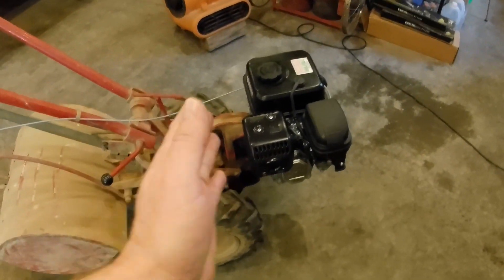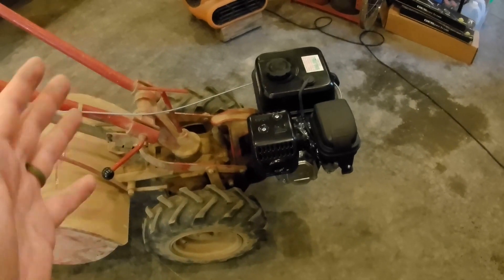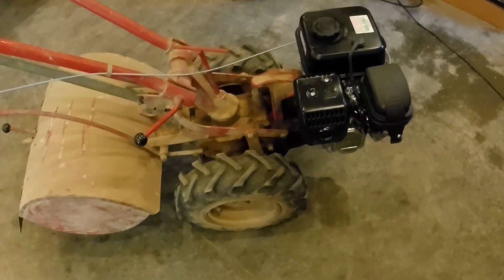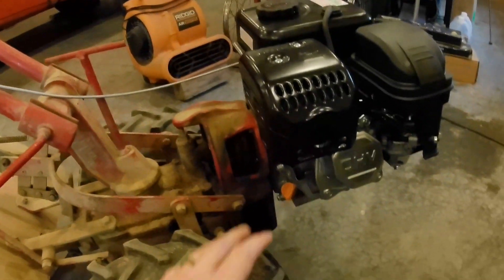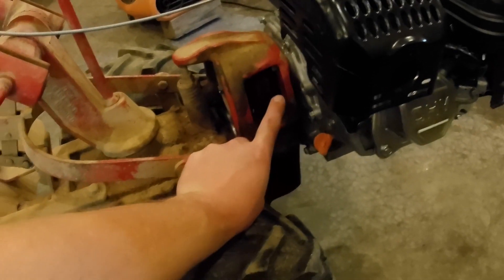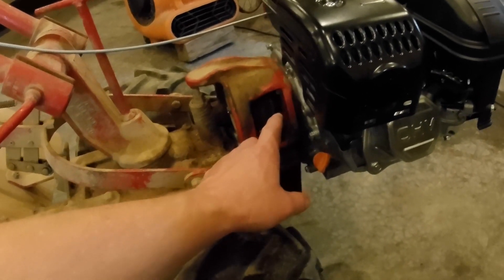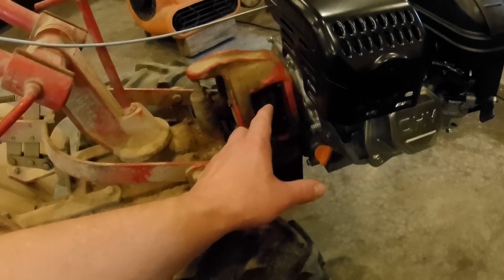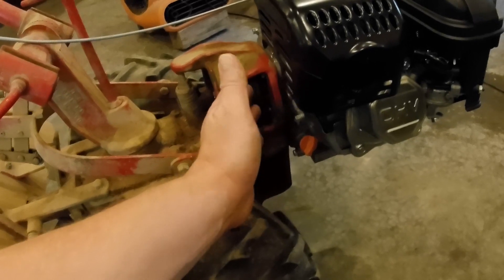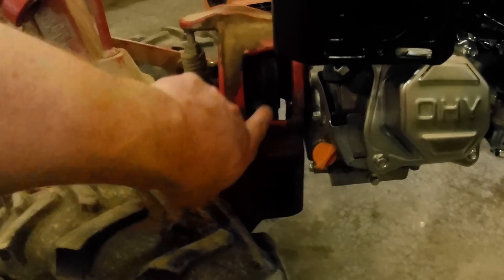The Predator allows the pulley to sit closer to the engine. So what you'll need to do this conversion — exactly what I did — was buy a Predator 212 engine, and because the shaft is three-quarter inch, buy yourself three or four three-quarter inch diameter washers to use as shims in case you need them.